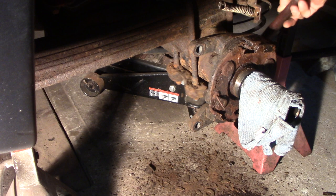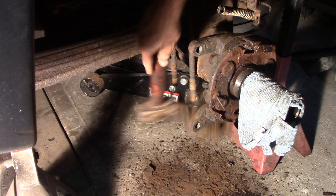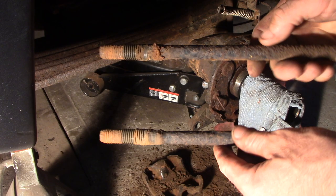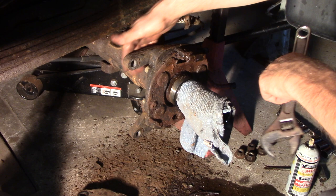Hopefully this plate will drop. I'll lift the plate up — it's 20-something dollars. Turns out I need it. That guy just went. There it goes — nice, huh? Yeah, so these are big honkers. See here, this is supposed to be the diameter — it got a little thin there. I wouldn't say it's half the diameter, but for 10 bucks you've got to replace it. These puppies came off pretty easy — 24 millimeter, came off the backside no problem.